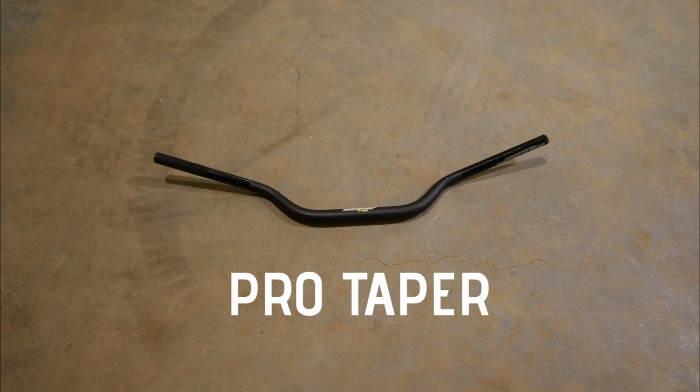They're a new bar for us, but they're very similar to ones that we've been using previously. And like you said, one of the easiest ways to do it is by measuring the hole distance on the OEM bars to the end of the bar grip. You actually have to plus 5mm, just because of how they're set up out the factory. So you're looking for that distance plus 5mm, and that will be the centre hole for your new security mount.